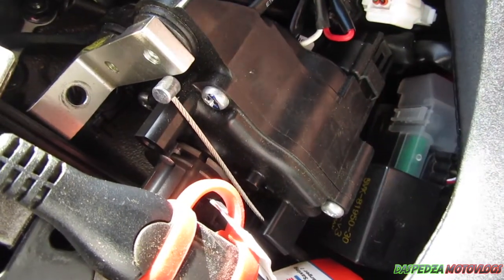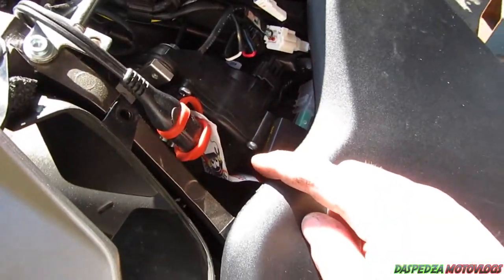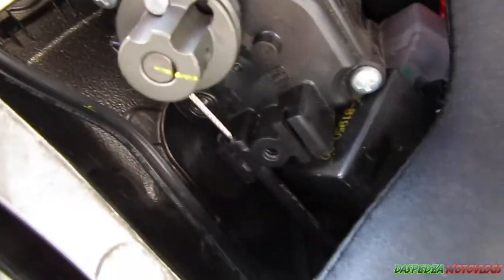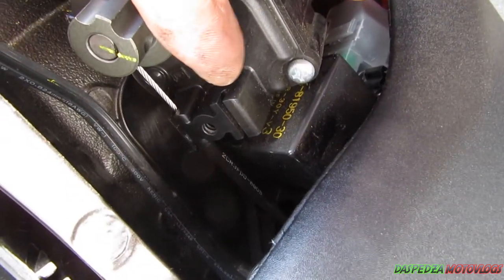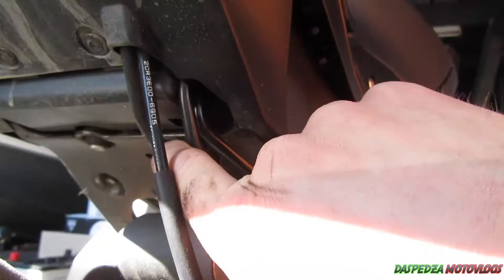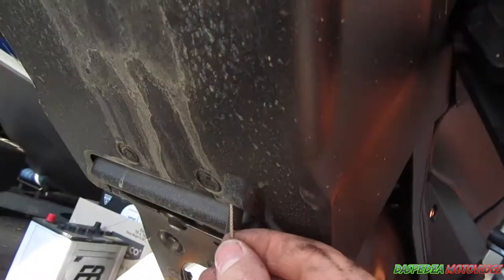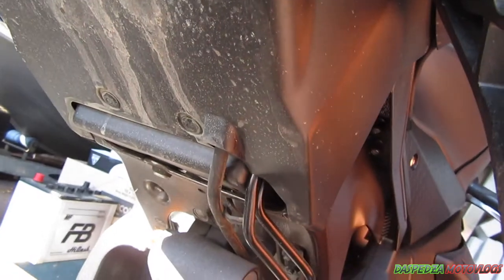Once that's done, all you've got to do is unclip the cable. I'll lift this servo up — it's a bit difficult because the sun's here — but unclip the cable out of there; you just pull back once it's off this little wheel. Then run the cable out of the back, which clips under there, and just feed this out and keep working it until you pull it out.